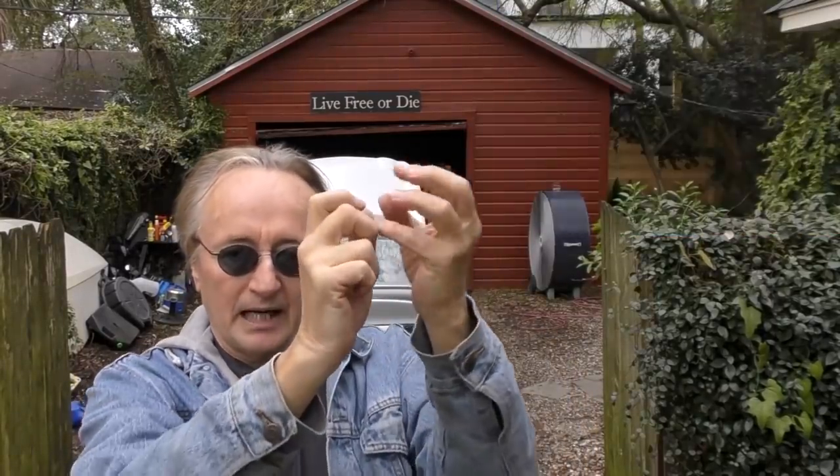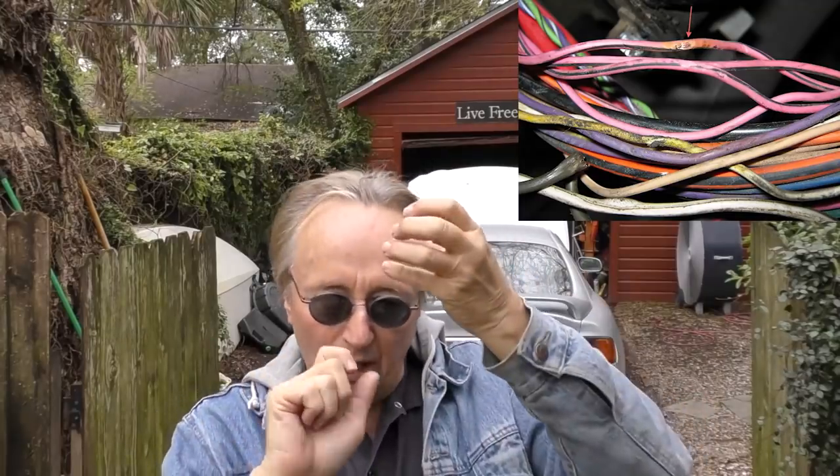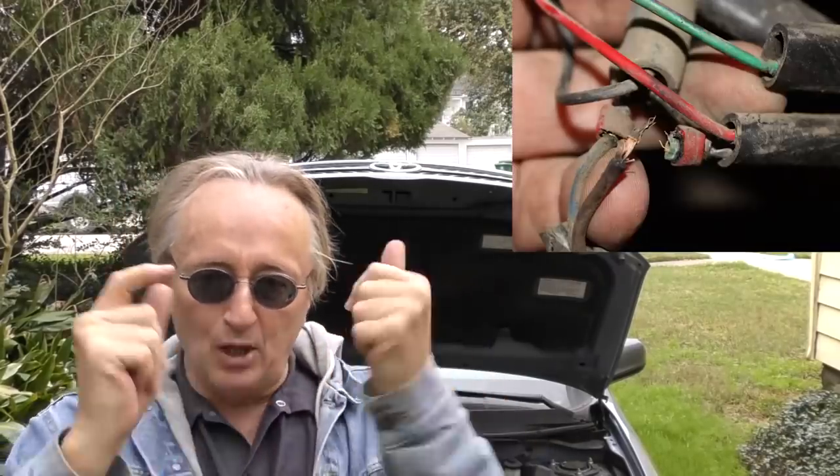Here's an extreme example: a customer added fancy LED lights that sparkled and played with music while driving. While drilling holes and bolting down the wiring harness, he accidentally drilled through the power supply wire to the fuel pump, nicking it. The screw holding the harness didn't short it immediately, but driving around — especially in a bouncy Honda Civic — eventually that screw connected the car body to the fuel pump power wire. I also see this with entertainment systems installed in the dash: the car won't start afterward, and I have to pull the radio out and check for cross-shorts that could ruin expensive computer modules like the body control module.